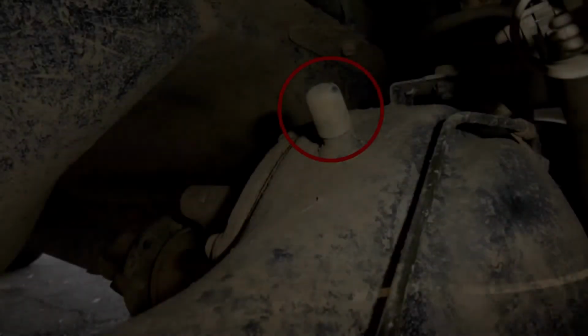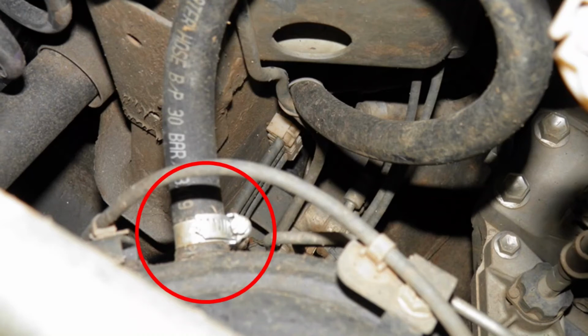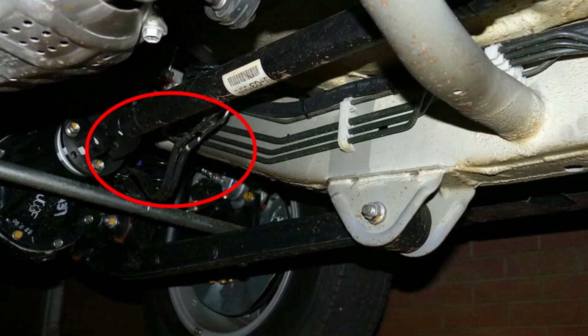The breathers are not very difficult to install. We've got a lot of forums that explained 100% how the guys did it. What you actually need to do is break off the cap of that little nipple that's on the standard diff and the transfer case, and you put over a pipe that fits that diameter. Then you lead that pipe along your chassis, keeping in mind that your car still flexes, so keep it as close to the ladder frame as possible, because that's the point underneath the chassis that doesn't move a lot. And you guide that pipe up to the highest point that you can.